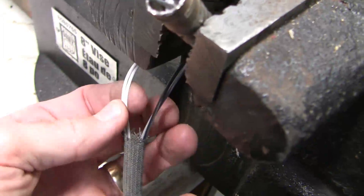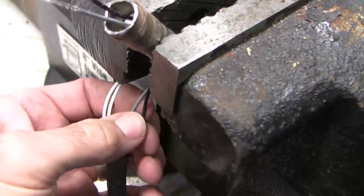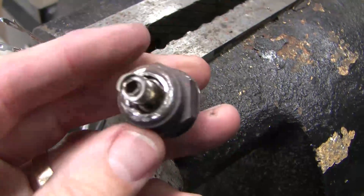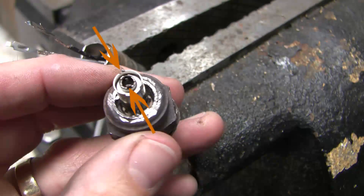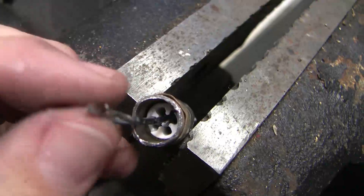This is a four-wire sensor. The two white wires are the heater wires and the gray and the black are the sensor wires. The gray and black connect to the two elements exposed to ambient oxygen on the outside and oxygen on the inside, comparing the voltage produced by the two of them. And deep inside you can see just a bit of the heater.